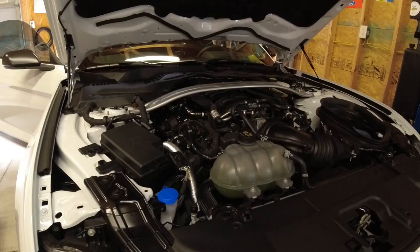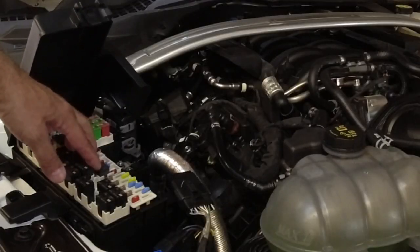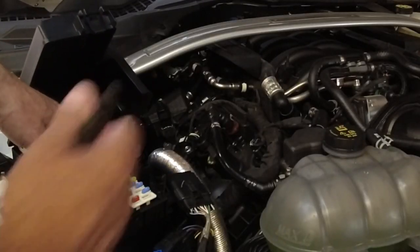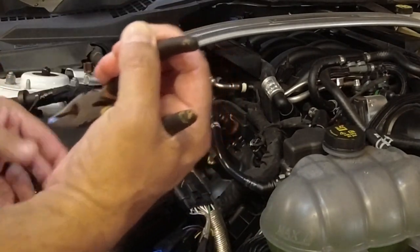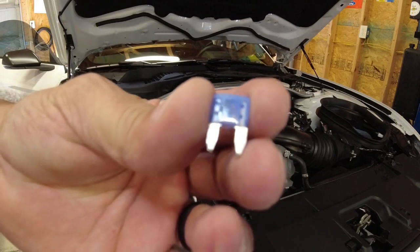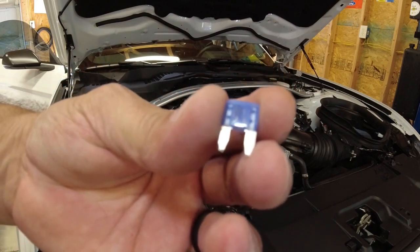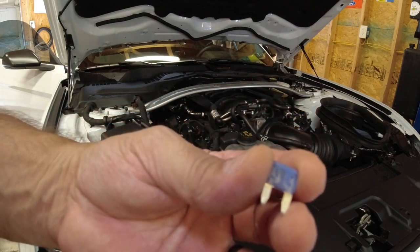Now to see if my hypothesis is correct, I'm going to check the fuse for the active exhaust. It's this fuse right here, located in between these two relays. It's a 15-amp fuse. You don't use metal on a fuse panel, but that's blown. So if a fuse is blown, that means there's a short, and if there's a short it's only coming from one area — I'm going to show you that next. I got to get this car up in the air.